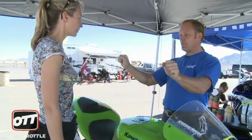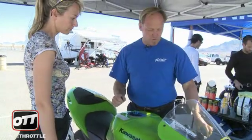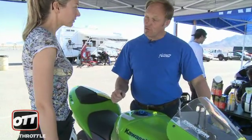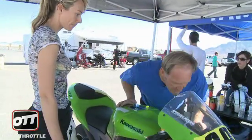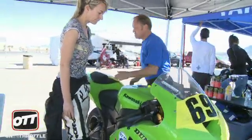So it's important to at least have them even. A lot of times, depending on what the rider wants, you can bring them in or push them out. Sometimes it doesn't seem like much movement, but at the end of the bar it's several millimeters, which can make turning a lot less effort and counter steering much easier, which will allow you to look ahead because you touch the bar and it starts to go. So let's go ahead and fix that first.